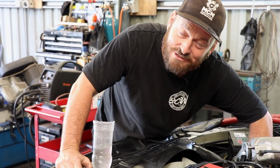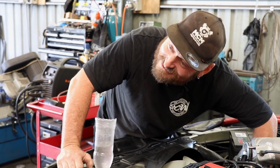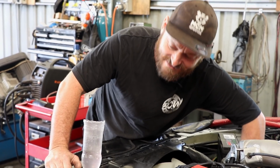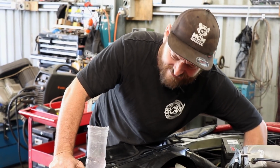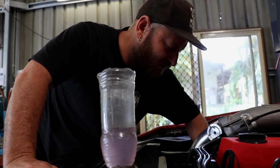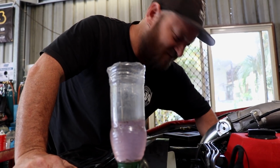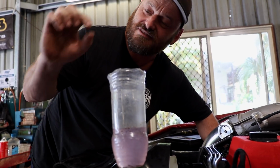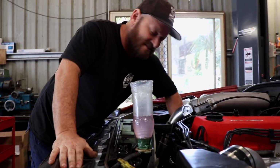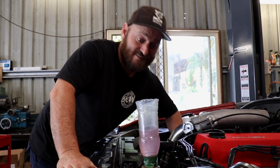Twins? Always single, because they're like the biggest engine this side of a, I don't know, Coyote V8. Very wide. We're talking a 41 or a 45? Oh, 41, I reckon. So I'm just pumping the bottom hose with my thumb. What that's doing is there's a little bleed hole in the thermostat just to let air come through. This sort of encourages it to come through prior to starting it up.